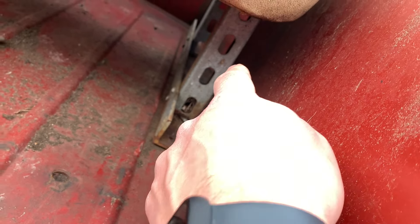I don't know exactly what happened here, but I really think we're going to go to Kaiser Willys and just get a whole new skin for the side and be done with it — do each side and go from there. We're nice and clean. I already got a brake pad for the pedal. We've got mostly solid floors and I think we're going to just run with it. We'll check the bracing underneath and go from there. We're going to decide if we want to keep this frame or use the frame on the yellow Jeep. We're going to make basically two nasty Jeeps into one decent Jeep. There's some Bondo and rivets back through there — it's kind of ugly, but there she is all cleaned up. Let's walk inside and I'll show you my yellow 77.